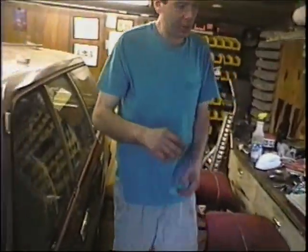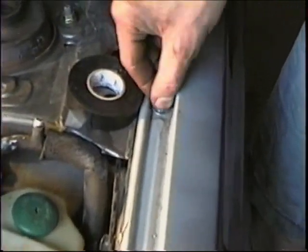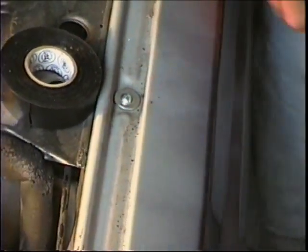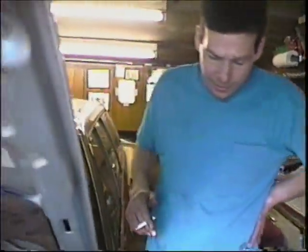Yeah, you can get these, they're called T-nuts. You put them in there and you can pop rivet them, and then you can just use standard. This is just standard SAE stuff. So it's like a threaded insert then. Right. It's just a matter of drilling out the old ones and then putting those in there. So yeah, it's all back together.